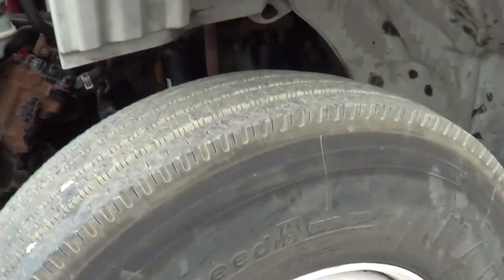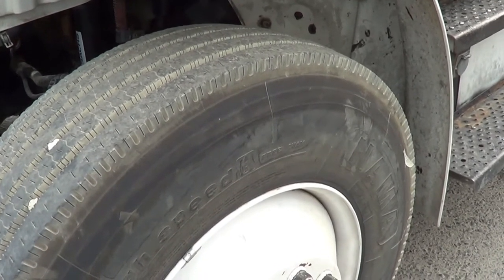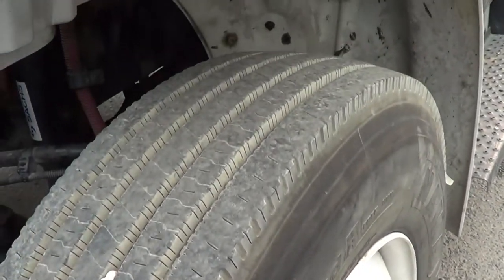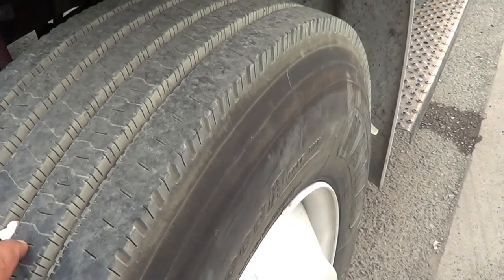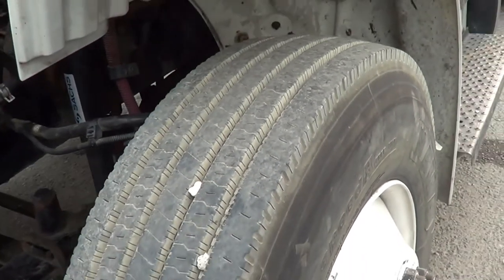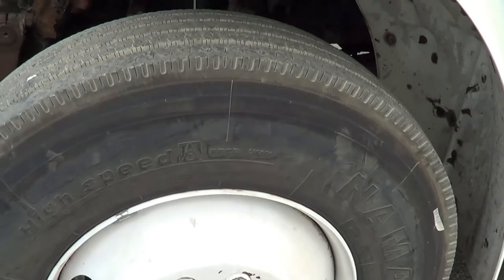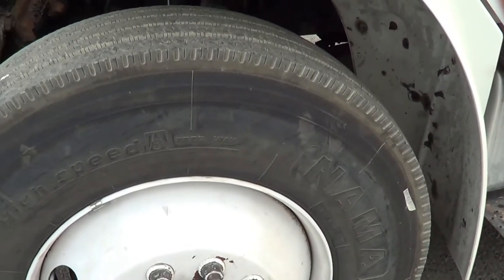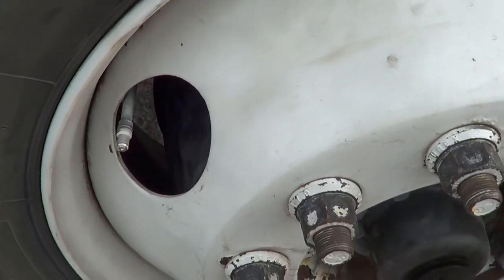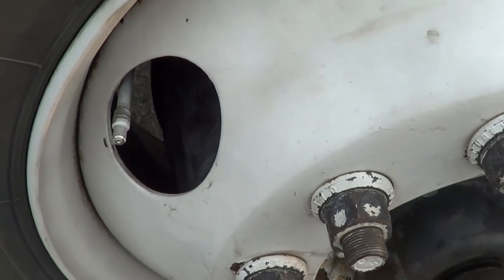Now I want to inspect my tire. My tire — this is a steering tire. Because it's a steering tire, it's not allowed to be regrooved, recapped, or retreaded, and it's not allowed to have less than 4/32 of an inch at the deepest part. This tire and the tire on the other side must have the same type of tread, cannot be mixed, and must be the same size. My inside tire, outside tire, and the face of my tire — no abrasions, bulges, cuts, or leaks, and properly seated to my rim. The air specification on my tire is 110 PSI or manufacturer specification. If I need to add or check air, I will do it through the valve stem. My valve stem — no crack, broken, or leaking, securely mounted, no missing hardware. My valve stem cap — in the tight position, no crack, broken, or leaking, no missing hardware.